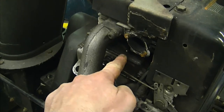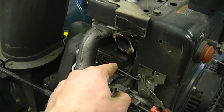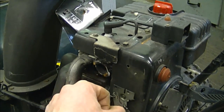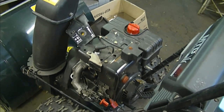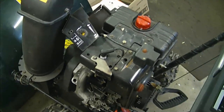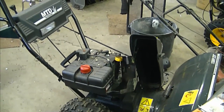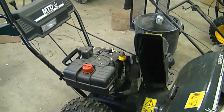You can also take off the cover and check the valve lash. You want .008 inch for the intake and .012 inch for the exhaust valve on these Tecumseh engines — and by the way, these are flathead engines, not overhead valve. I've had the same experience myself: I replaced a carburetor and the engine was still backfiring until I adjusted the valves. Sometimes if the valves are too far gone you may have to replace them. If you do most of the work yourself it's probably worth it, but some shops will be so expensive it won't be, so count the cost before committing.